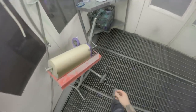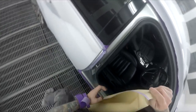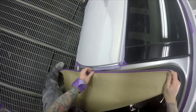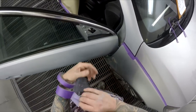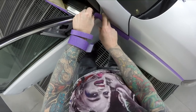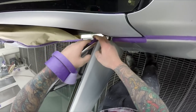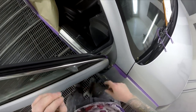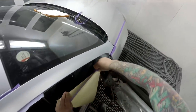I like to put a piece of paper down the front of the back door. Always get a bit of tape over this rubber here before you shut this door too — you'd probably struggle to get that one masked otherwise. Sometimes we'll do a bit of this action just to help keep a bit of overspray out of that door jamb.